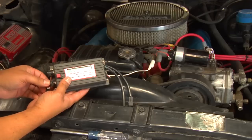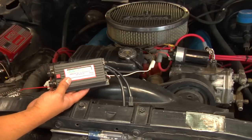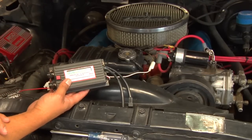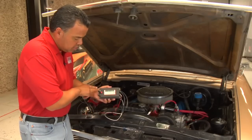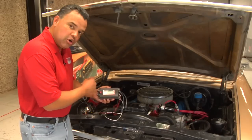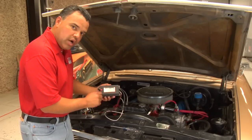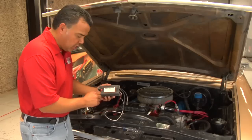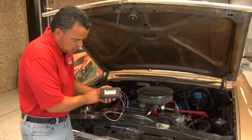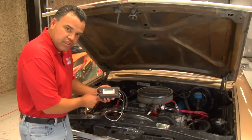Or if you need fine RPM, that fine RPM setting is for your RPM activated switches, your TACs, your shift lights, or anything that is hooked up to the MSD box. The ignition box itself offers both a coarse RPM setting, which is your faster RPM, and a fine RPM setting. So if you're meticulous about what RPM your shift lights turn on, you can turn the coarse knob and then fine tune it with the fine tune RPM.